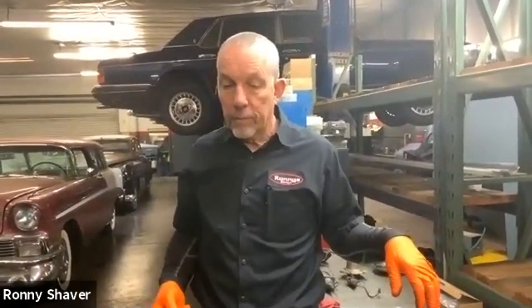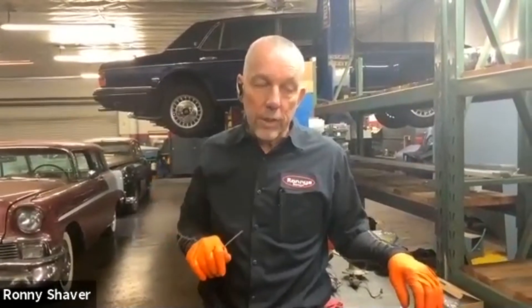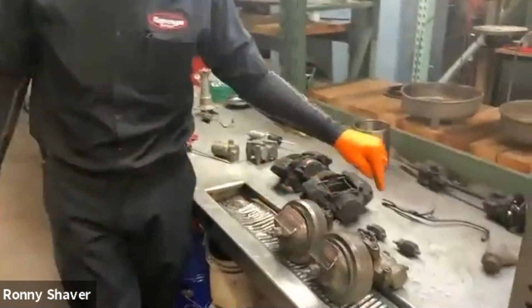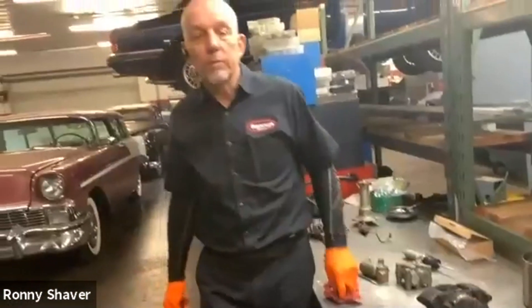If you start your car in the morning and you don't see any pressure lights, that's okay. What you want to do is turn the car off, turn the ignition back on, and start pumping the brakes. You want to depressurize these — you want to get these to make those lights come on. If you pump away for a hundred pumps and you never see the lights come on, then your lights are not working. You've got a problem.